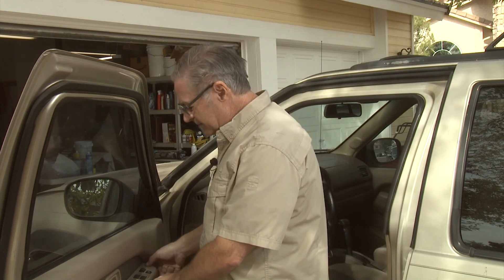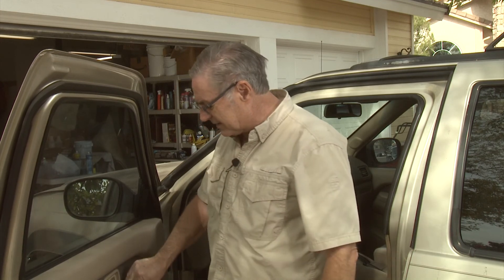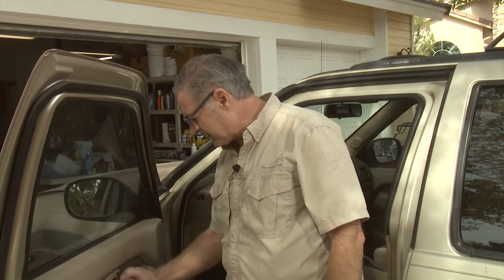So we're going to go ahead and put this back together again. When looking at switches online, you'll notice you're going to be paying a couple hundred dollars if you try to replace this switch. That's why it's worth going ahead and working with contact cleaners to get it to work as best you can. Just pop it back in. We hope you found this instructive. This is a principle-based video, so it'll work on any kind of switches you have — any contacts that have issues, go ahead and use the contact cleaner to help get those working better. Be sure to subscribe, and we appreciate you using the links in our video below. Have a good day.